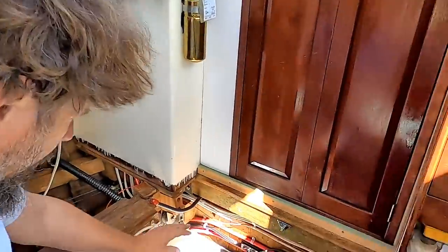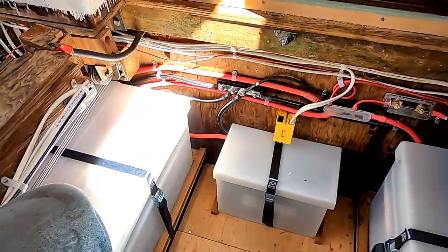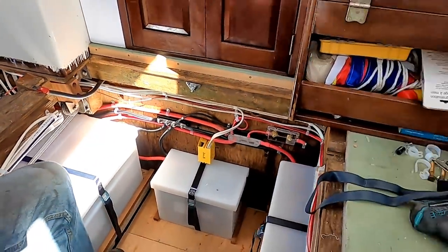And there we go — all lids on and strapped down. I am just so pleased with this. Turned out to be a very, very slick setup. Just two more notes: there's the cable forward to the windlass which I have to relocate to attach to the main bus, and the heavy wires will have to be sheathed in another layer of protection to take advantage of the ABYC 40-inch rule for overload protection. The main fuse — in this case it's a breaker — is normally supposed to be within seven inches of the battery, but if you sheath the cables you can go up to 40 inches, which I can comply with at the helm console.